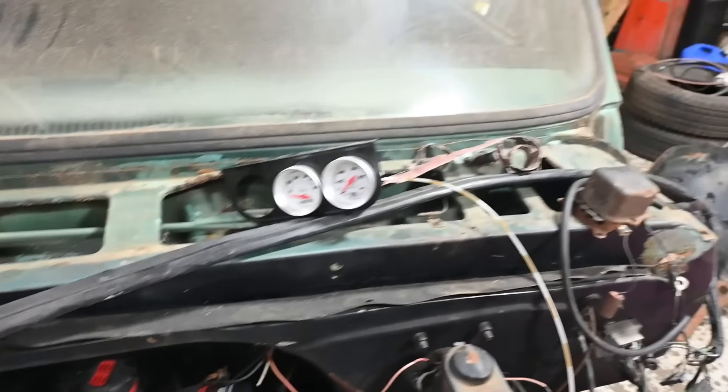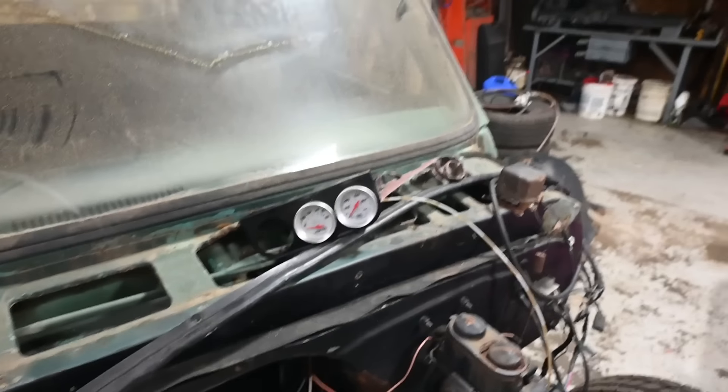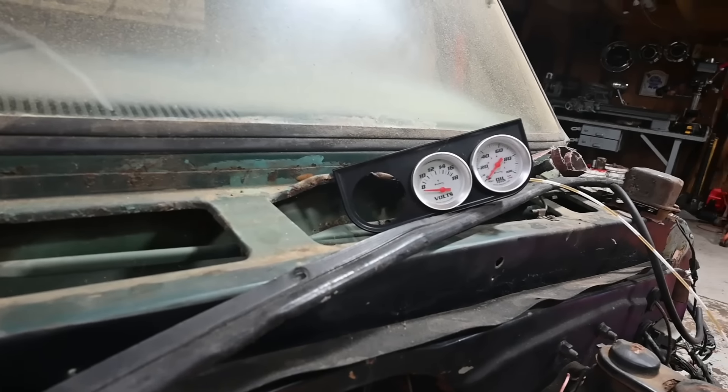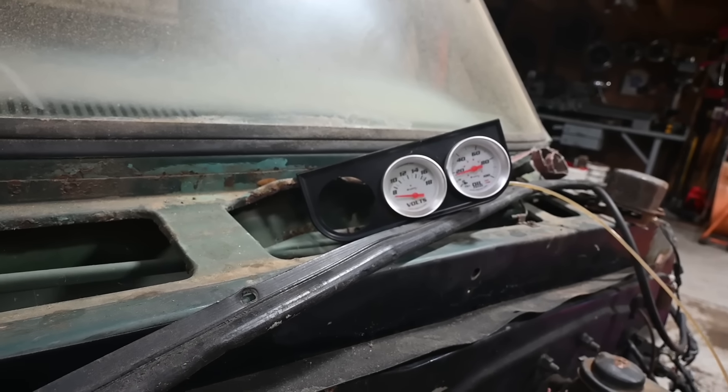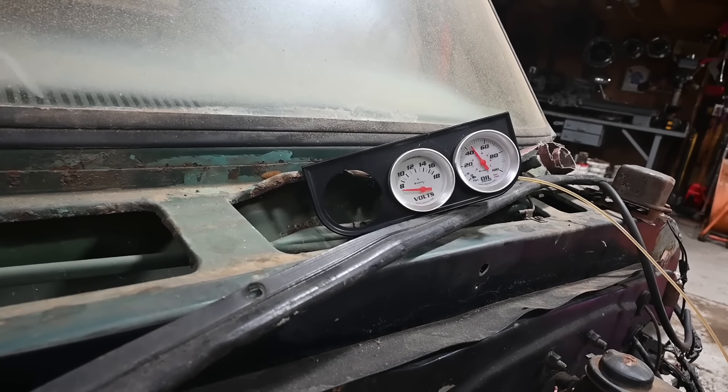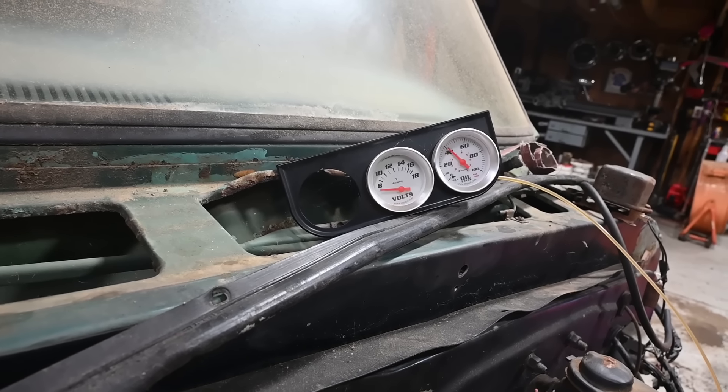Before I pull my prime tool out - I had it in there the other day just to prime everything up - let me crank it up real quick to check oil pressure. That little drill is about dead but you can see it was creeping up to 50 PSI, which is pretty good. That thing was maybe spending around 1,000 RPMs, so right about where it's going to be idling. Looks good to me.